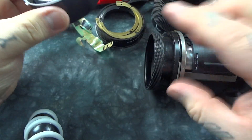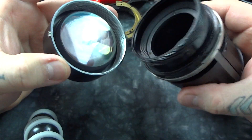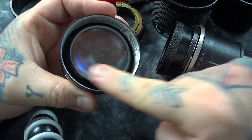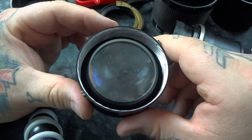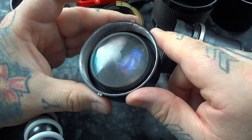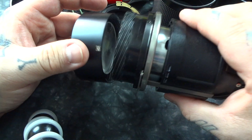That is lens haze. The only thing different is I actually rubbed my finger, took that grease right there, and — that is lens haze, boy! You don't get your lens hot in a car, or leave your lens in an attic, because the helicoid grease will atomize and then it will take a poop on your elements. That ain't nice. It's exactly like smearing Vaseline on your lens. And since this is on the inside, reaching it is, let's call it difficult. You're going to have to pay someone money to fix it, and if it's a cheap lens, it ain't worth fixing.